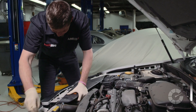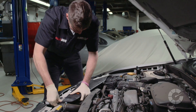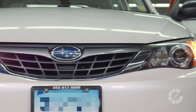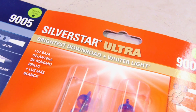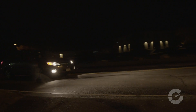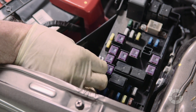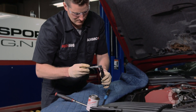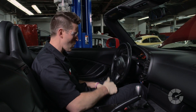It's a good idea to replace bulbs in pairs. If one side blew out, there's a good chance the other side is not far behind. Driving around with only one headlight is not smart, but replacing your bulbs is pretty easy. And if you upgrade to brighter bulbs, it'll help you see better for your nighttime drives. For more how-to car repair videos, visit autoblog.com/wrenched. I'm Larry Kosilla from Ammonyc.com. As always, thanks for watching.